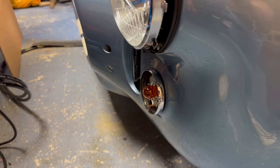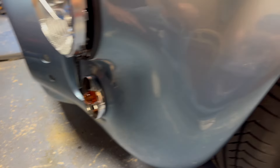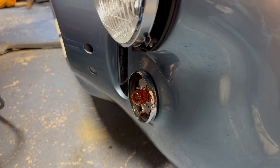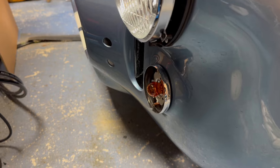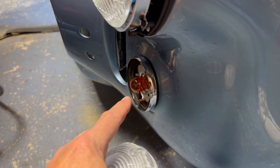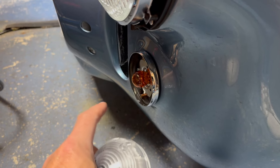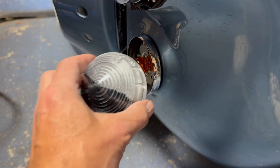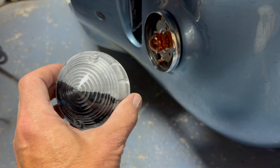Your indicators need to be at a certain minimum height. You can adjust this by raising the suspension, but that's a lot of turns and only gets you so far. The rule is that no part of the indicator can be below the minimum height - which seems strict, but even if there's more light available, you must ensure no indicator light shows below that minimum. And this must be done in a non-removable way.